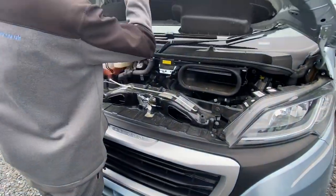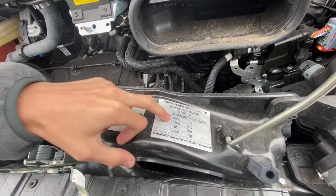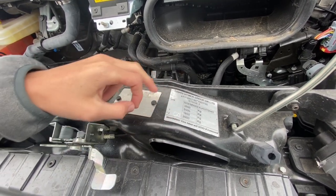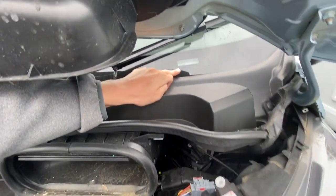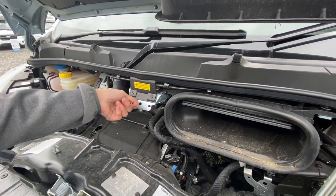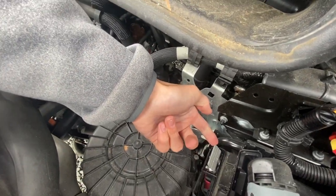Put the stay on. You've got your weight plate from when it was converted into a motorhome — it's 3.5 tonne gross vehicle weight. If you put a trailer on you can carry an extra 2 tonne, and you've got your front and back axle weights and your chassis number on the window. This is your earth for your jump leads or charger — earth here, then positive: put the key in, lift this cover back and connect your positive here.